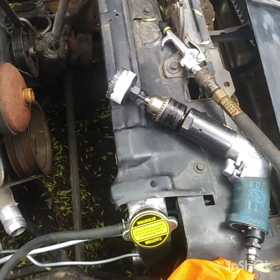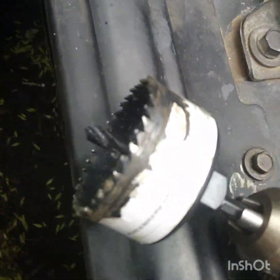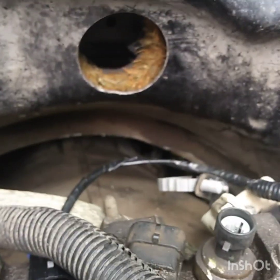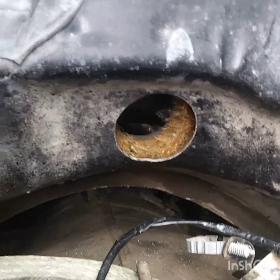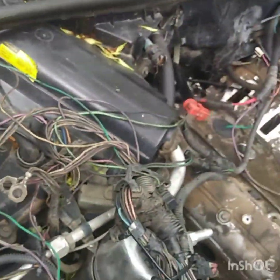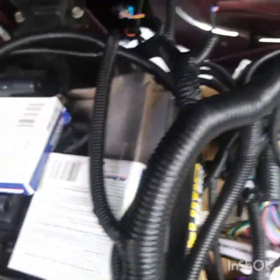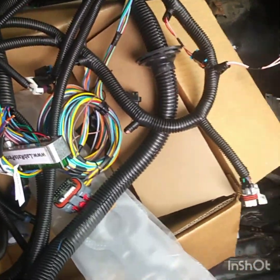Just giving y'all a quick shot showing you what I got going on with this one. You can see I got my tools out — hopefully you can hear me, I got a compressor running. What I had to do was take a two-inch hole saw and drill this hole out in the firewall. The customer wants his harness ran on the inside, and the harnesses come with a two-inch boot to seal it up. I'm gonna be feeding this harness from the inside, coming out that hole and going straight out to the engine.